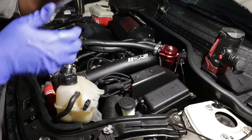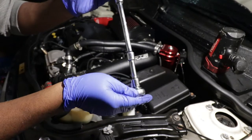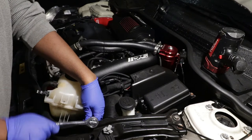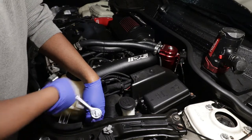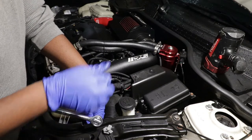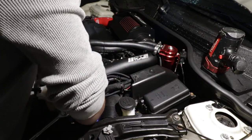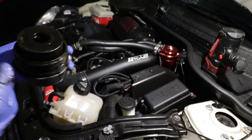Since that area is buried, I made a combination of this. So this is 27mm. I have this swivel set right here, and I have an extension made out of two different pieces. I'm going to go ahead now and attempt to remove that. When you torque it back — when you put the filter and you torque it back — it's 24.5 Nm. It's actually even written on the cap. There you go, finally, it's out.